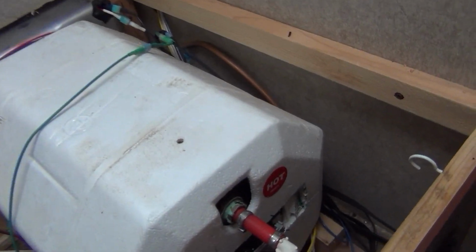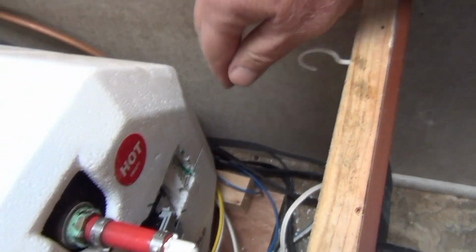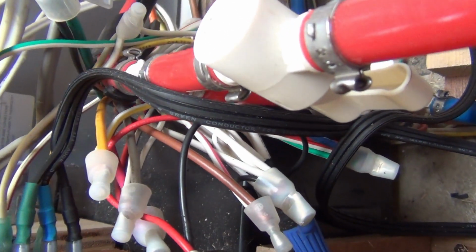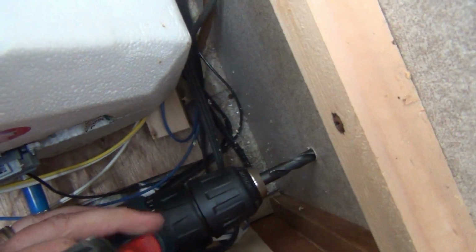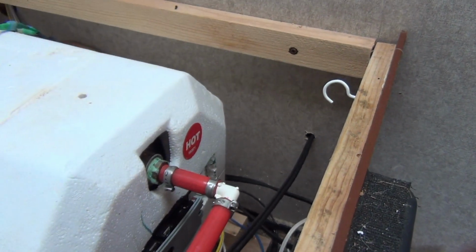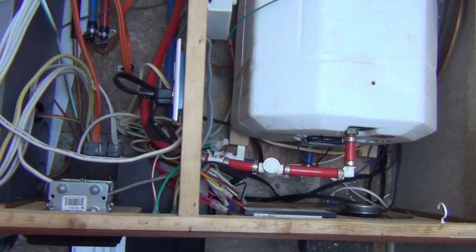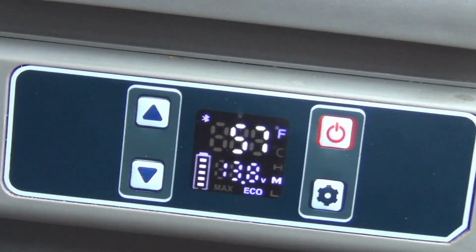Right behind the back wall is a dinette seat. I'll bore a hole here and run the wire under the seating. The power panel is right here, so I'll be able to tap 12 volt power. That is, if I can figure out this tangle of wires. I pull the wires through the hole, leaving enough outside to secure it to the compartment walls. I find a suitable 12-volt source and tap the wires into it. Now I plug in the fridge's 12-volt pigtail and the refrigerator comes to life.